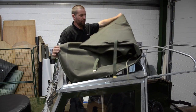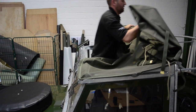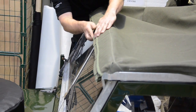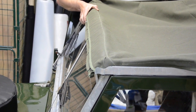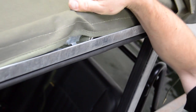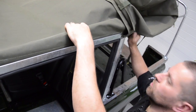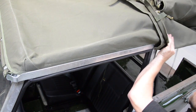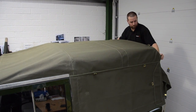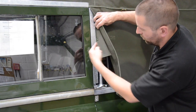Get the hood through and up onto the bars, making sure you're at the front. Unfold it a bit — it helps it hold itself on the bars further away. Then gradually hook all the tabs over at the front and work your way along the side. The over-doors have two tabs inside that you hook the pipe in through. These are a bit fiddly to get at because they're set quite low in the channels, but they just need to hook in behind. Pull the hood down and tighten the cord up a bit, then unfold the rest of the hood to the back.